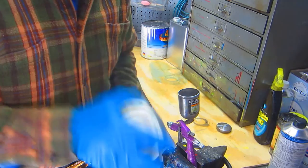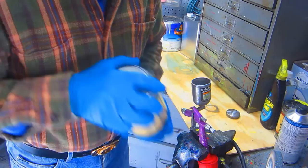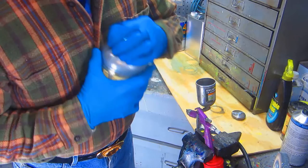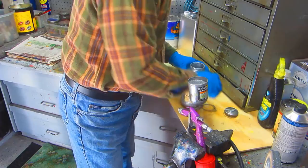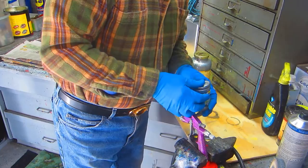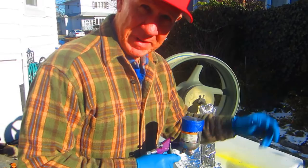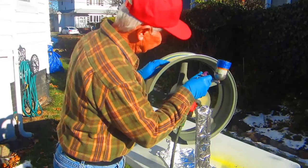With silver you've got to be really careful — there's a lot of pigment in here, and if I don't shake the gun every once in a while, it's going to settle to the bottom and some parts will be a slightly different color. I did my test the other day and I really liked the color — it has a nice bright look but it doesn't have that cheesy fake-chrome look. I've also made sure to mix enough paint so that a year from now, if I want to touch this up or paint more wheels, I've got enough to do two wheels.